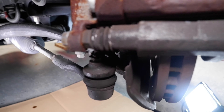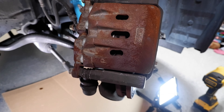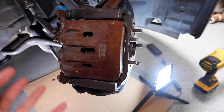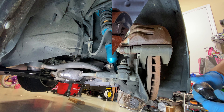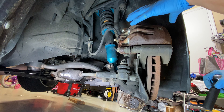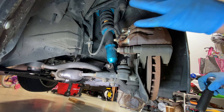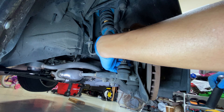I've got to pop off this cover to get access to that bolt down here, and I need to loosen the caliper and swing it out of the way. To take off the caliper, you could loosen it up top — which just takes off the caliper part and leaves the bracket, and that's what you usually do for pad changes — but what I'm going to do is release it from the spindle, which uses the two 17-millimeter bolts in the back.